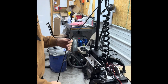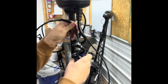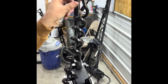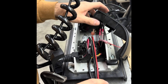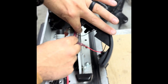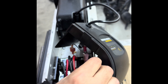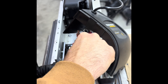Now I want to run my wire down through the coil cord — you want it to come out the bottom, so put all your slack out. One question we get a lot: people call saying their new head's not working. At this point you're going to disconnect the black and white wires — they're just a male and female end. These two wires will be free. I suggest heat-shrinking them so there's no corrosion and you don't have any open wires.